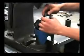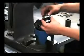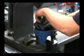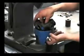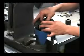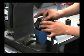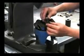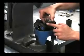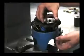Also check your main bearings and make sure they don't feel lumpy and that they turn nice and smooth. From here you can pull out that connecting rod and inspect these flat areas for any wear that would be enough to fill with your thumbnail, and replace as necessary.